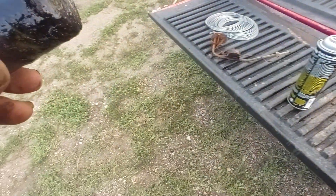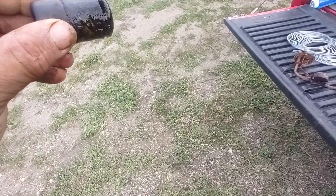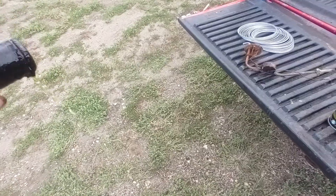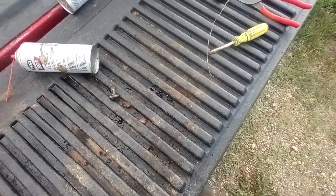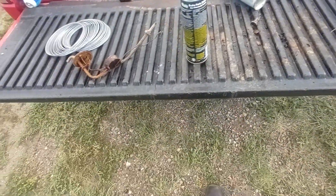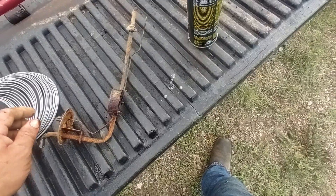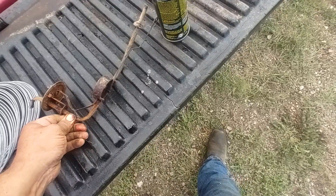And the float has a hole in it, you can see. So I'm going to take and see if I can find a new tank for it, because look inside the tank — what I can see is just scaly and rusty as all hell too. Ideally, it needs a new sending unit and tank.